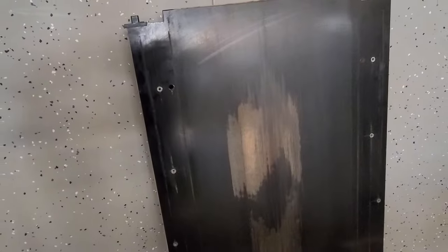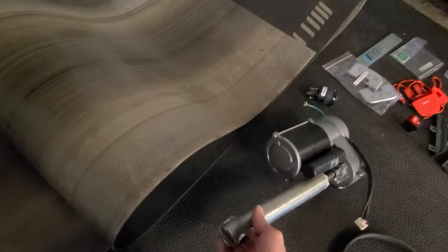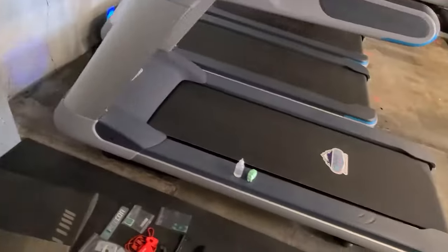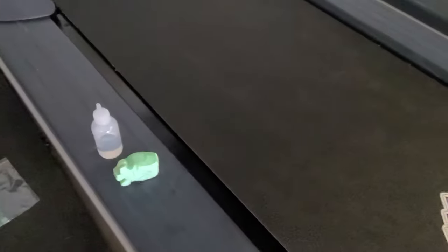As you can see here, I've got a used deck that is unusable because it's starting to show the wood from the inside of the deck, and that's from it being dry. If you look at the belt, you can see the streaks it's creating, which is going to slow down the belt while you're running on it. It can also throw up error codes for your lift motor and lift box — it can cause a whole bunch of problems.